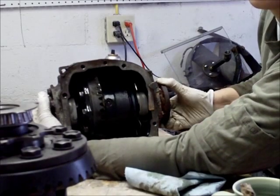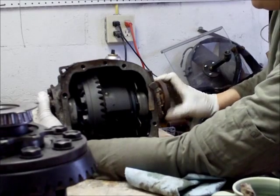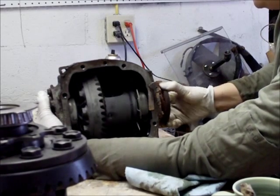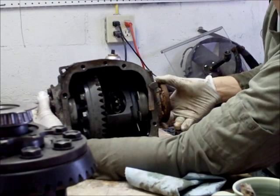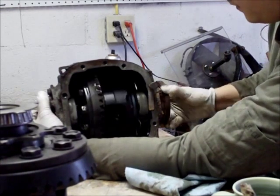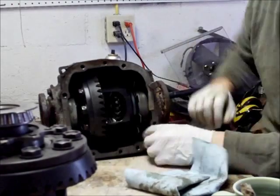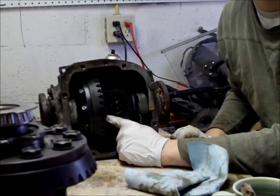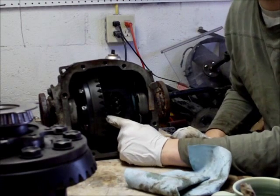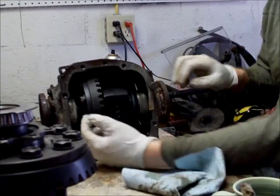So under different cornering instances, the outside wheel will receive all of the torque. The reason I'm showing this first is that this spider gear sub-assembly is the exact same as inside of an LSD — it's just a smaller, more compact version and it's got clutches on either side.